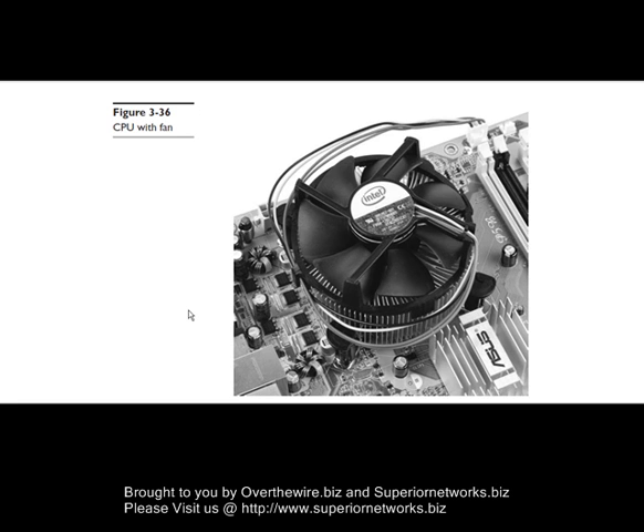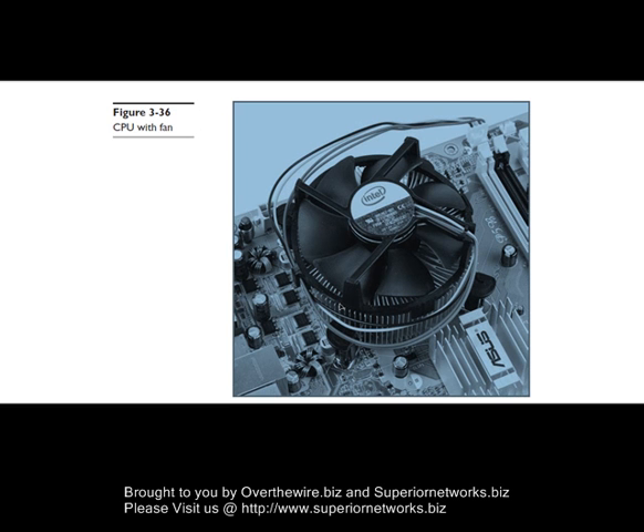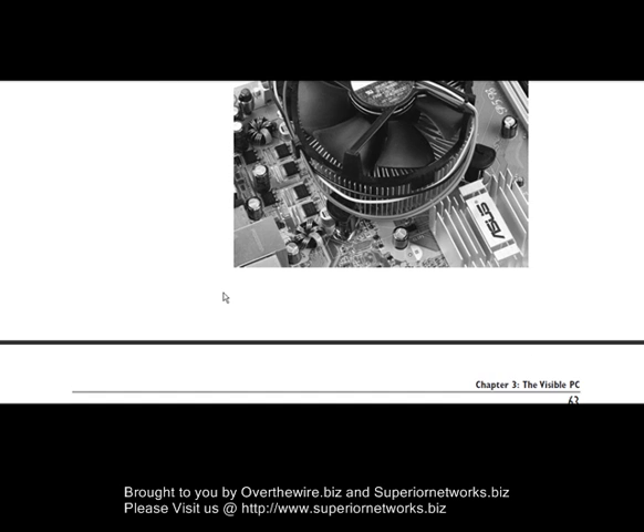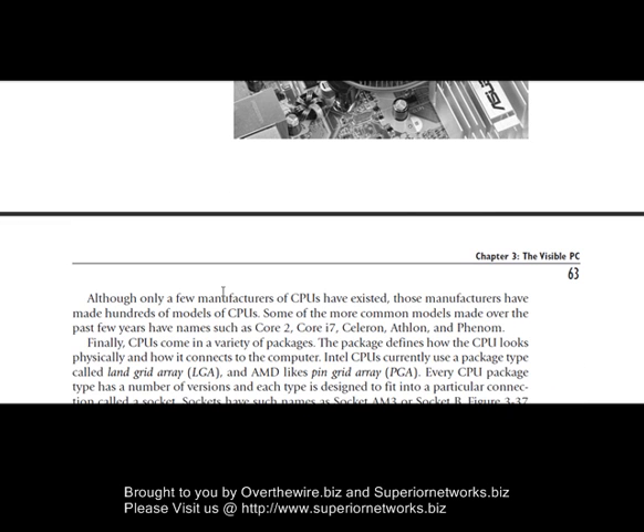We have the heatsink and the fan. The heatsink is this item right here underneath the fan — it looks like a bunch of little cards, basically blades of metal. What it does is draw the heat away from the chip itself, so instead of the chip being hot, the heatsink is. The heatsink still needs to be cooled off, so it draws the heat away — it's basically made out of aluminum. The fan will take that heat by blowing it out of the machine. Since aluminum cools very quickly when air is pushed against it, it is probably the perfect mechanism to cool a CPU.